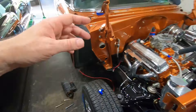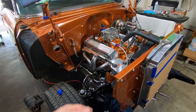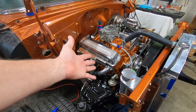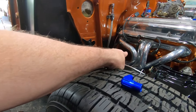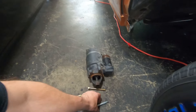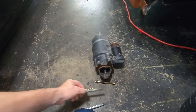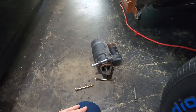Here's another problem. All the cars I've worked on are mainly mid-to-late 70s up through the 1990s small block Chevys — I have no experience with these older 60s and 50s blocks. The issue on this 1964 327 is this old stock starter, which weighs about 50 pounds. I always run mini starters, especially with headers, because heat soak is a problem. He had this one rebuilt so I'm going to use it. When I took the car apart it had standard bolts that weren't even long enough — only grabbing four or five threads. I specced out actual starter bolts with knurling, but they came in and don't fit through the starter.